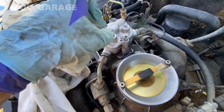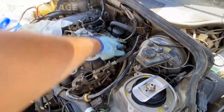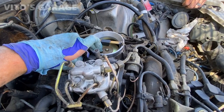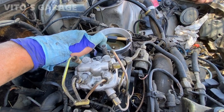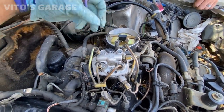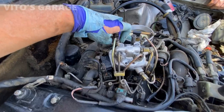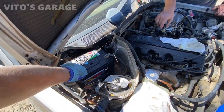A couple scratches here and there. That's a good sign, man. Really good sign. Because when the pumps are running and the lines are off, there should be no fuel coming out. Only when you push the airflow plate. Mechanical fuel injection.